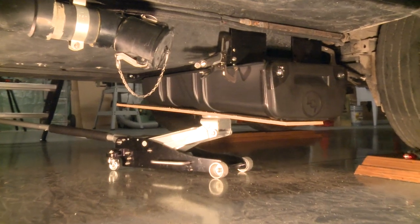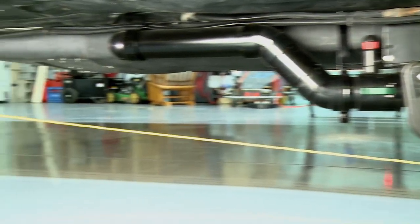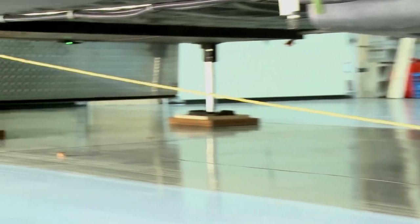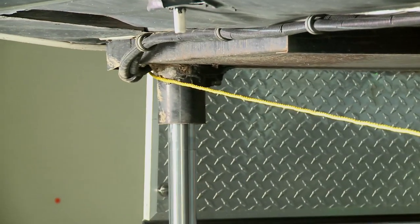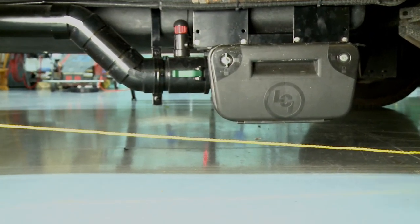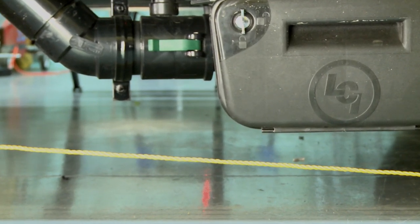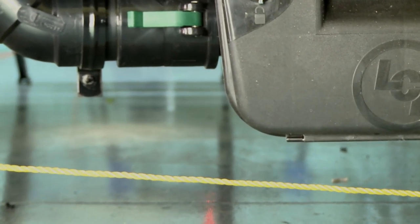I've also mounted my box close to the front wheel of the trailer. I could have moved it closer to the tank discharge fitting, but then it would have been covering part of the access panel that comes off to allow access to the Drainmaster electric dump valves, should I ever need to change one. I did have one fail, and Doug actually sent me a free replacement. There's another aspect to storage box ground clearance — Doug says that if you draw a line from the bottom of the front tire to the top of the front jack on the underside of the trailer, nothing should be below that line to avoid it getting hit on uneven ground. You can see here that even though the storage box looks quite low, it's still above our line by about three and a half inches.